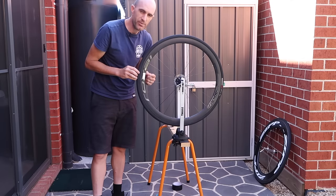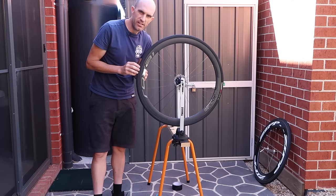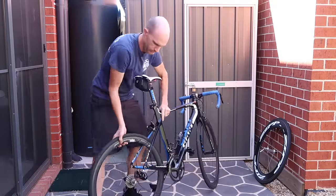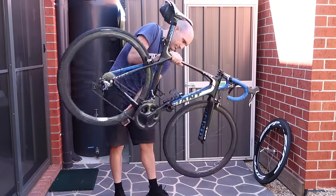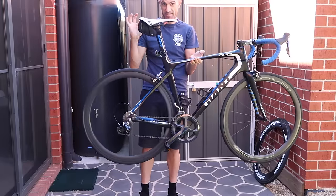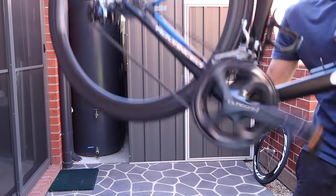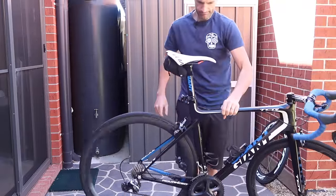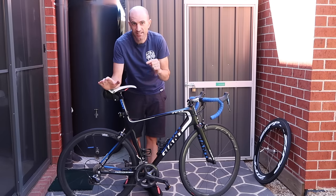On the 808 I put a bit of black tape over the top — you can also use tubular glue to stick the weights to the rim. If you're worried about aerodynamics, I guess you can put dimples on these little things. Marginal gains, remember? Spinning the wheel up to speed — spot on. There's no shake. That is a world of difference. The chain wasn't shaking, the bike wasn't resonating at all. That's done really, really well.